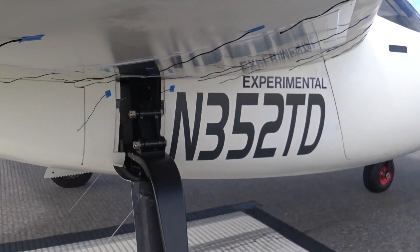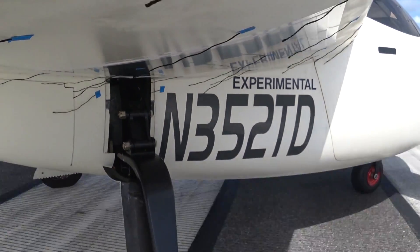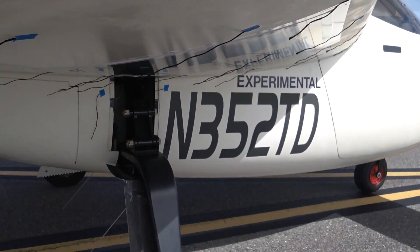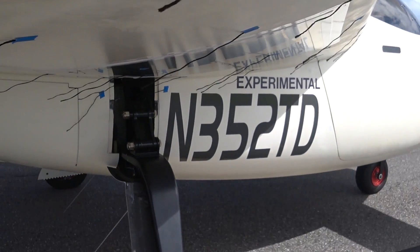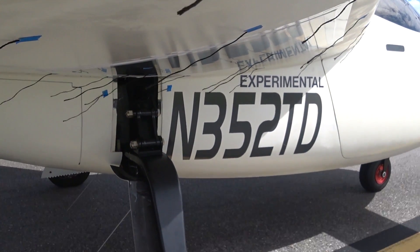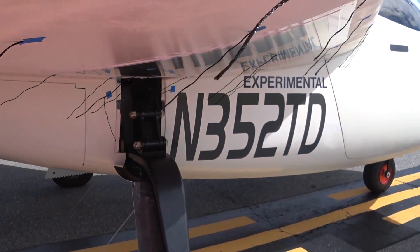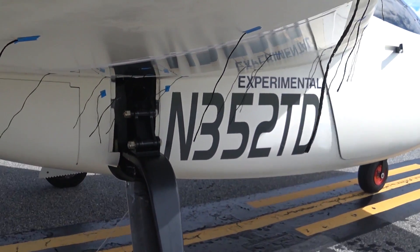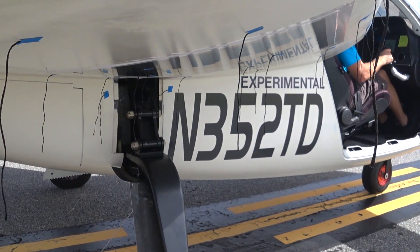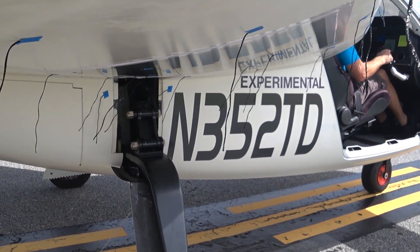Hopefully next week I'll have the new coolant tanks. In the meantime I've already moved some weight forward into the nose and I'll be measuring weight and balance next week to confirm the CG is more forward. The 8% static margin wasn't enough — Mark recommended 10% at the top end — so I'm going to take the static margin to 10% and I think it'll fly a lot better at that point. Thanks for watching, tune in next week to see where I'm at with this level of testing.